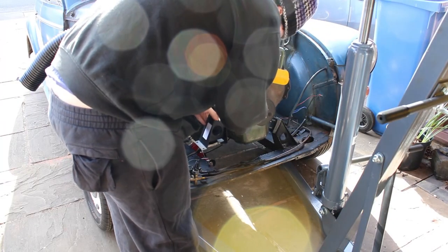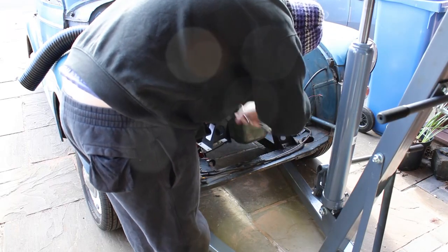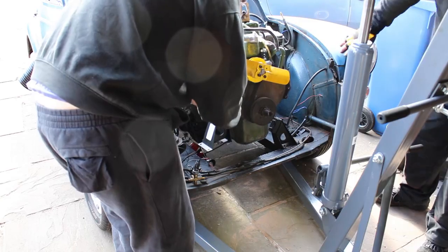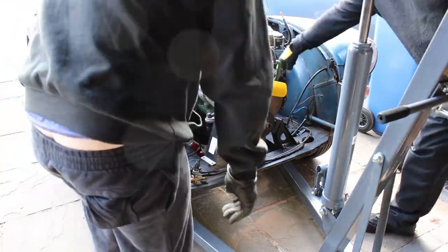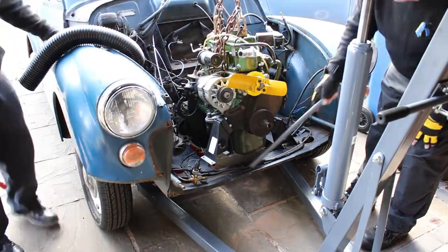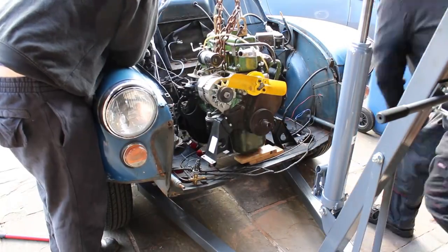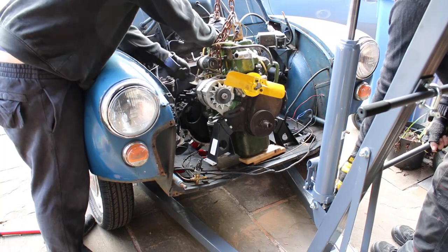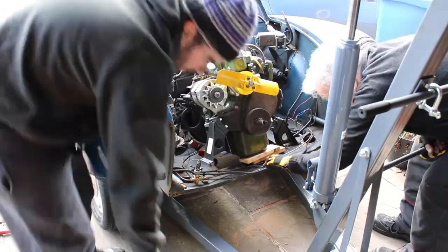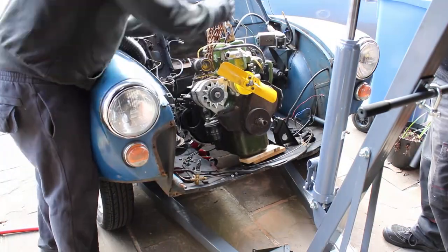So when lowering it down, I had to be very, very careful. This is me and my dad doing it. One of the little quirks is that you cannot install the engine with both of the engine mounts in place — you actually have to have one attached to the engine and one attached to the body, because of the way the bolts are. They kind of have to be levered into position. It's a good thing somebody told me this. They're brand new engine mounts because the old ones were getting rusty. My dad had a pretty good idea of putting some blocks of wood so the engine would come down on them. Another thing to be really careful of is that if the engine hits the shaft of the gearbox, it could bend it, which would kill the gearbox. I got a bit worried I'd done this at one point, but I never did.